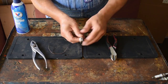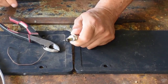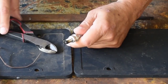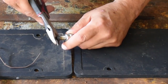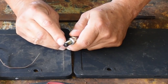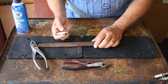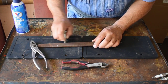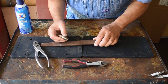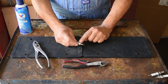Here's how you do it. You get yourself a spark plug. The first thing you're going to do is bend the negative electrode away from the positive electrode. You can see that the negative electrode has been bent away from the center electrode, the positive electrode. Go ahead and use the diagonal cutters to snip off as much as possible. Now we want to get that little nub out of there so we can increase the level of performance of this spark tester. What we do is take a file, lay it down, and we're trying to remove as much of that little negative electrode as possible. Now you can buy one of these for $10, $12, $15, $20, but why buy one when it's so much more satisfying to make your own tools?